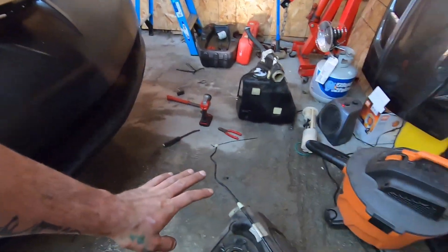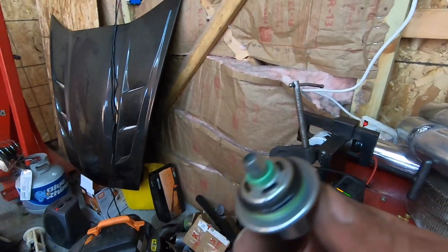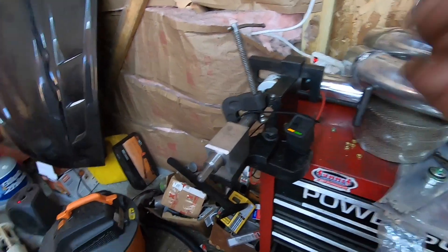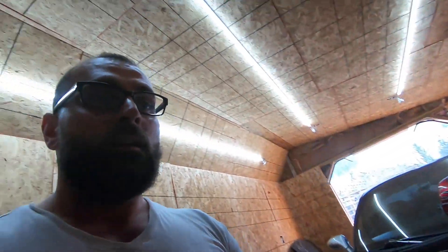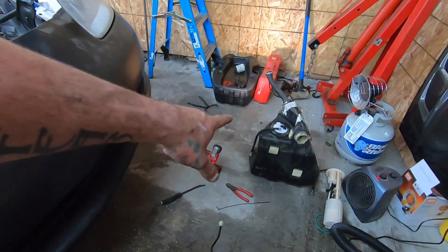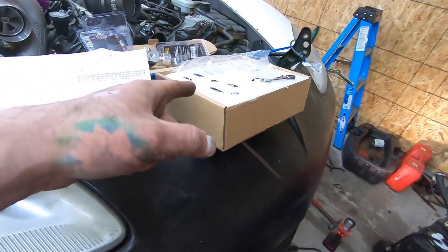Alright guys, we got both in. That fuel pressure regulator piece — I didn't see the plastic piece that was holding it in, but you can see it in the time lapse. You just pull the little plastic piece out, pop this out, pop the new one in. It's an O-ring seal so it's kind of hard to push in, but once you get it popped in everything goes right back together. The new pump is in. I'm going to end up throwing this tank in since we're pretty much done with this side, and then get the crossover in. I don't want to put the other one in until we start getting the return line run, so we can run it right along with the feed.